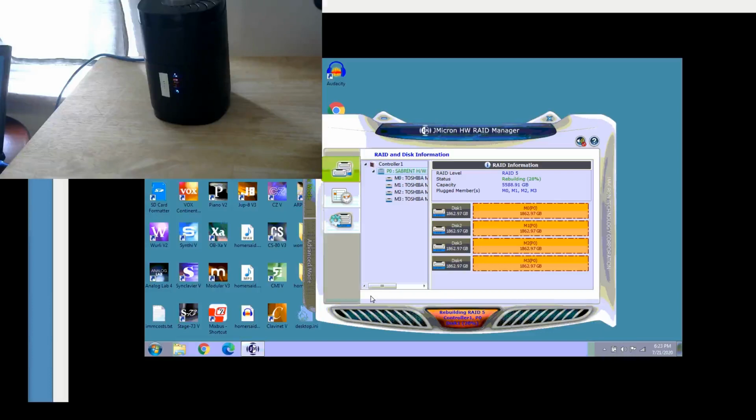So I said, okay, fine. So then I went and got another laptop that has a similar version of Linux on it, unplugged it from this one, booted to Linux on that one, and plugged the Sabrent into that. And of course, it's still rebuilding while it's doing this, and it had the same problem. So it just cannot mount this drive.